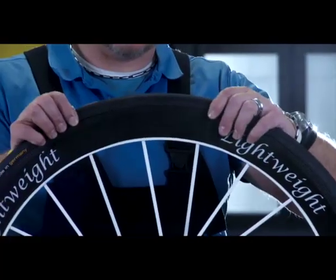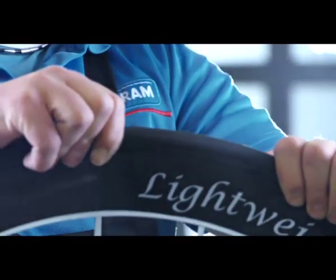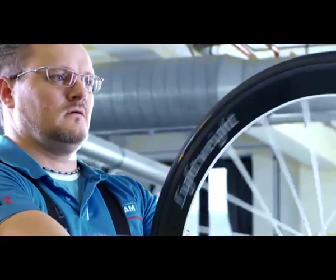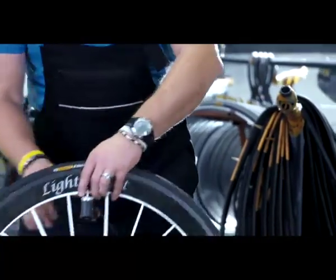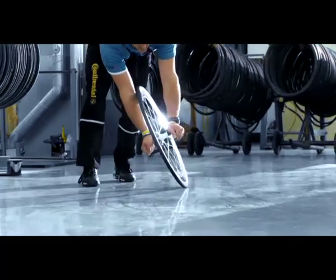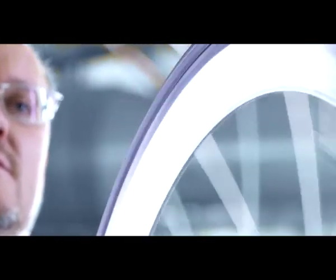Once the tire is in the bed, it must be centered and aligned — very seldom does the tire run true immediately. Check the tire over the entire circumference: the seam protector must be aligned equally to the left and to the right. If the tread is not centered or if the tire wobbles to the side, lift the corresponding section from the rim, twist it slightly, and let it go. Put the wheel back in the truing stand, allow it to rotate, check it again, and make fine adjustments. If the tire has no lateral run-out, remove the wheel from the stand and inflate the tire fully. Apply load to the wheel using the axle journal and quick clamp, roll it along the floor for several meters both vertical and tilted to the side, then check that it runs true and has no radial run-out.